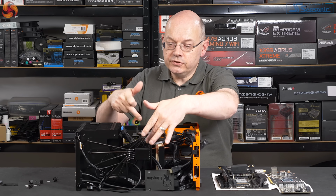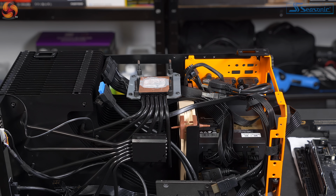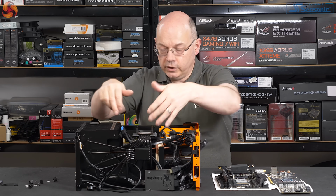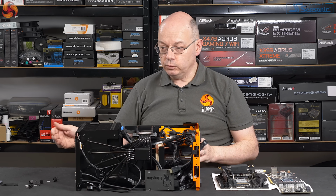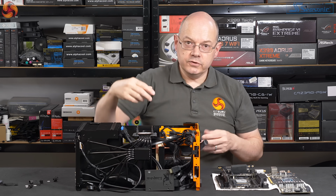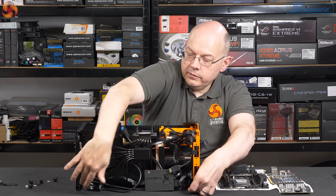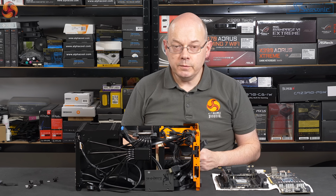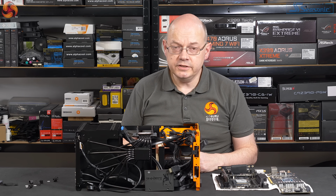And here we have the 2 cold plates, CPU and GPU, that both go to the same heatsink via 6 heat pipes apiece. The chassis consists of a great big heatsink with the cold plates and the heat pipes. Here we have a large bracket that runs the full length. And then on the front we have those 2 stud struts, call them what you will, that form these pieces here. And in between we've got a bunch of bits and pieces that actually turn it into a PC. It's a fascinating approach, and in terms of PC cooling, I've never seen anything quite like it.